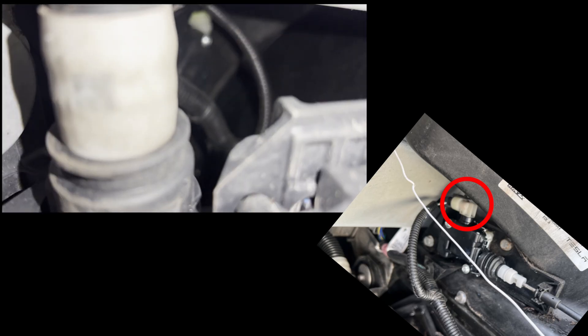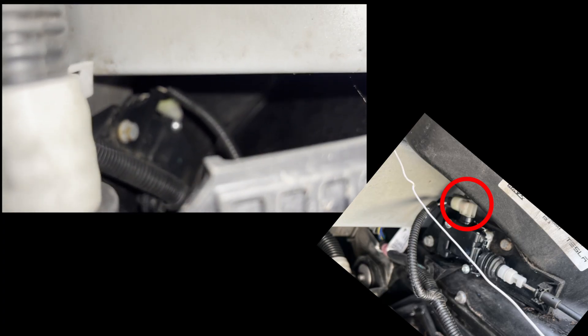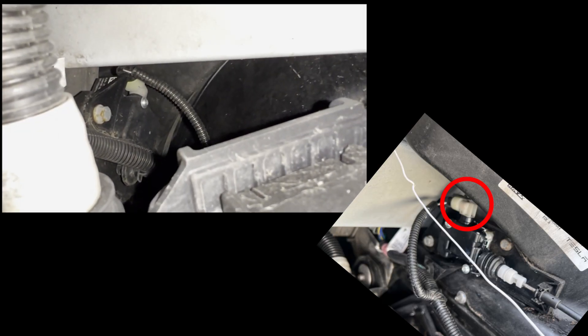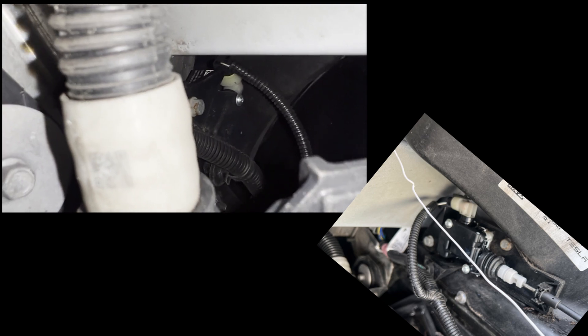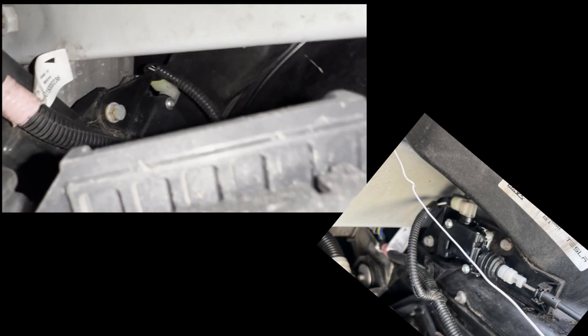With the tray out of the way, look for the little solenoid that pops the frunk open — it's behind the centre of the bumper, inward of the headlight. You can see where the cable goes in with a white piece of plastic. You won't be able to see it directly looking under the bumper, so you need to reach your hand through and unclip the white part, which will just pull away and slide off the mechanism.